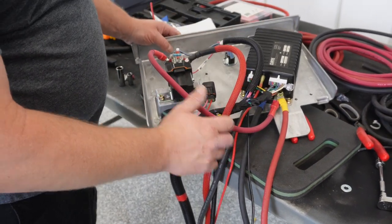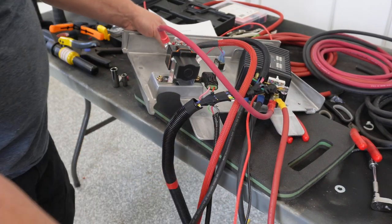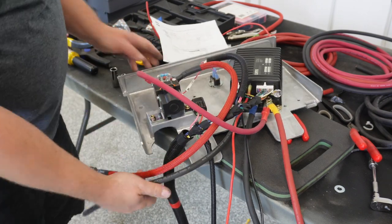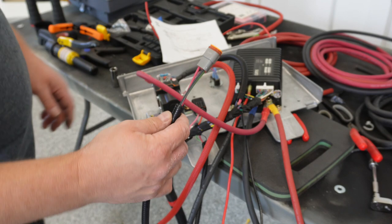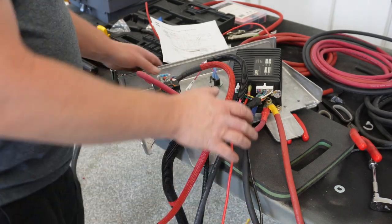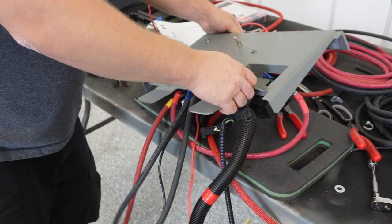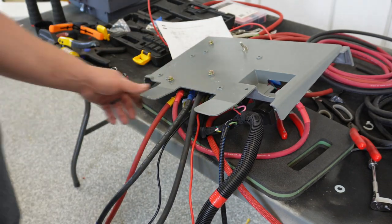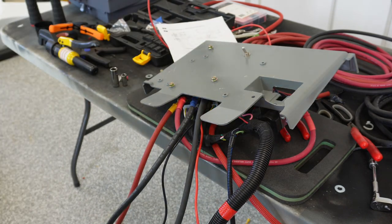There's what the back looks like. These are my four motor leads, my positive and negative for my battery — which may have to be changed — and this one is going to plug into the speed sensor on the motor. So that is basically it, ready to drop in. Now I've got my nice pretty paint all messed up because I was impatient. So what I'll probably do at the end of the day is mask some of this off, give it another spray, and then let it sit and get good and dry before we drop it in the cart.